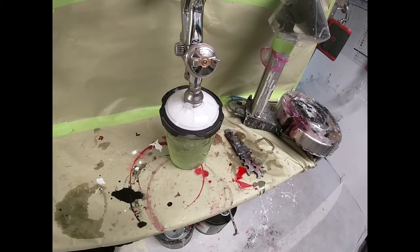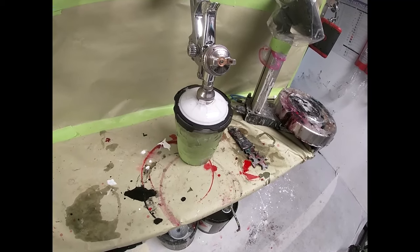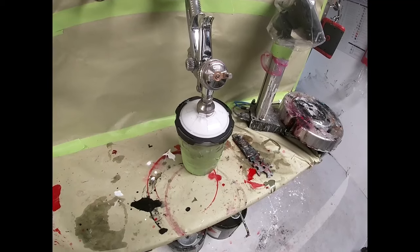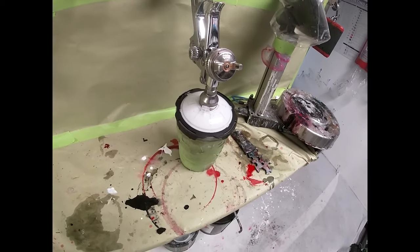It's going to let me see if my base is covered completely. In the collision world, you're just going for achieving hiding. In the restoration world, not so much — we want full coverage. So I like to use a slightly darker sealer than straight white for a white paint job.